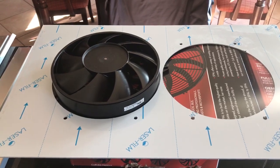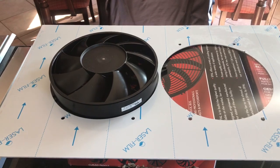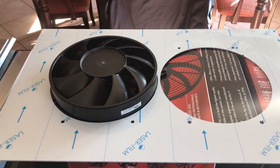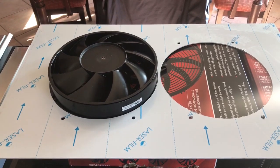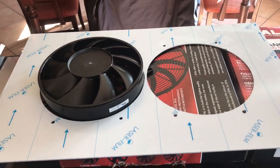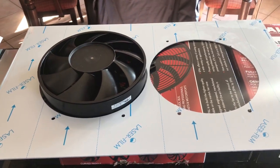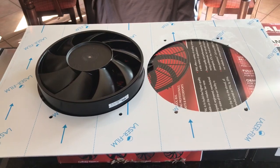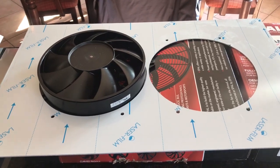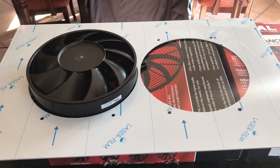The other thing is, without a fan shroud, those fans fit flush on the radiator but are a good half to three quarters of an inch taller. So from a packaging standpoint, this is an ideal solution. From an airflow standpoint, this is the highest performing solution you can get given the size of the fans.